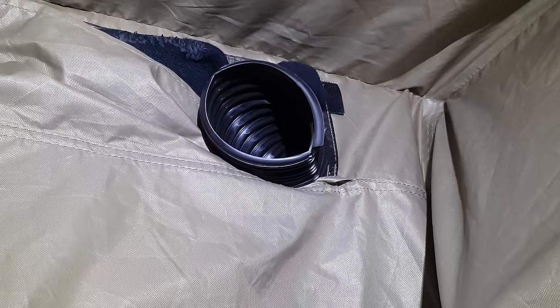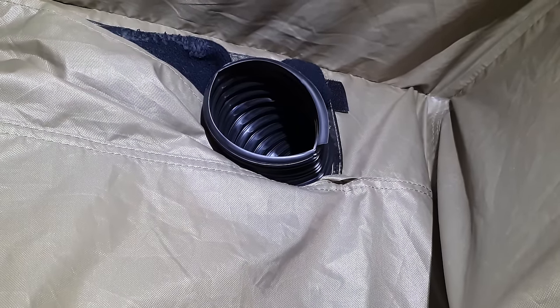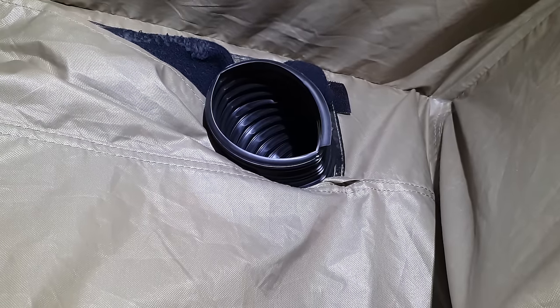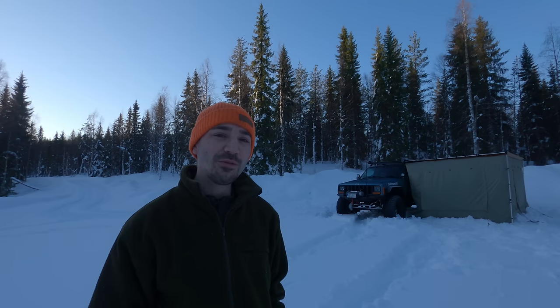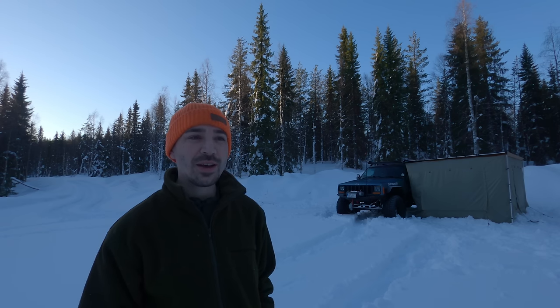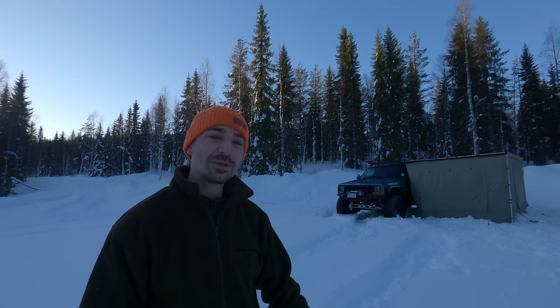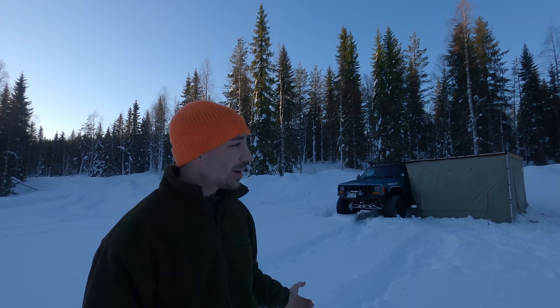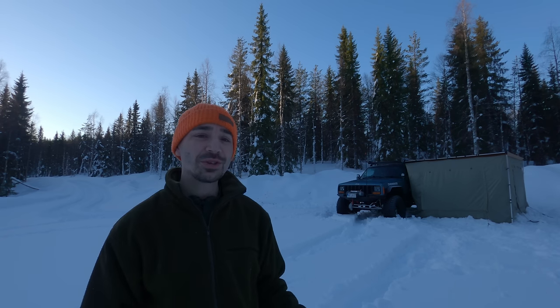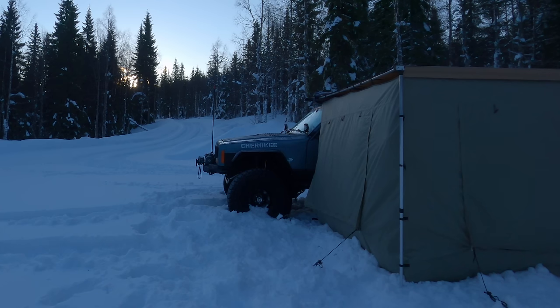And I've cranked the heater up now to about 4.5 hertz. And you really kind of need that with the awning room. The thing I've found is if you're running it anywhere below about 4 hertz, it just isn't pumping in enough air to fight with the loss of heat, and it always remains cold on the floor level. But when you crank it up to 4.5, it really forces the air in. It balloons the awning room out, and you feel the heat low down.